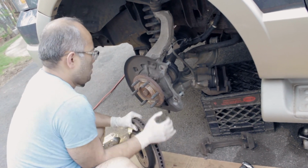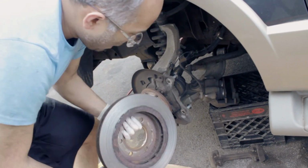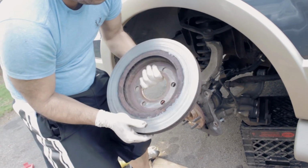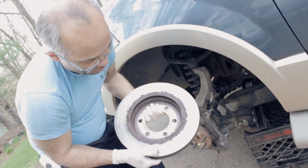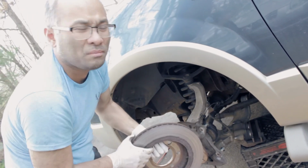There you go, little loop. We kicked it earlier, so kind of good in a way. And I can see the brake pad is totally down, and it starts gripping this rotor, so we have to replace it. Pretty bad, you do not want to continue with it, and it's much cheaper to put a new one in and just try to fix the rotors.